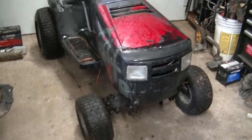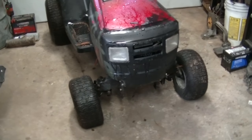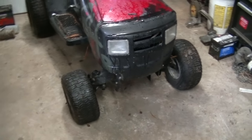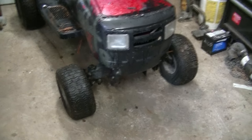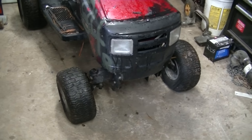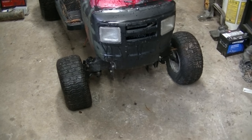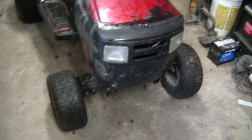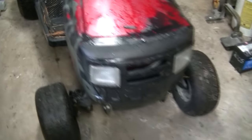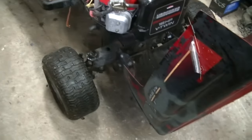As I've been burning brain cells on Fugazi here trying to figure out what's what and how I'm going to do things, I keep looking at the front end. I'm going to be doing a custom bumper, probably changing out the front wheels, custom exhausts — that's going to affect the front end. There may be a winch of some kind on there. Long and short of it is, the front end is going to be affected. Now, as you guys know, when you open the hood, the nose tips forward — way forward. And if you've got some kind of bumper assembly there, that's going to be an interference problem.